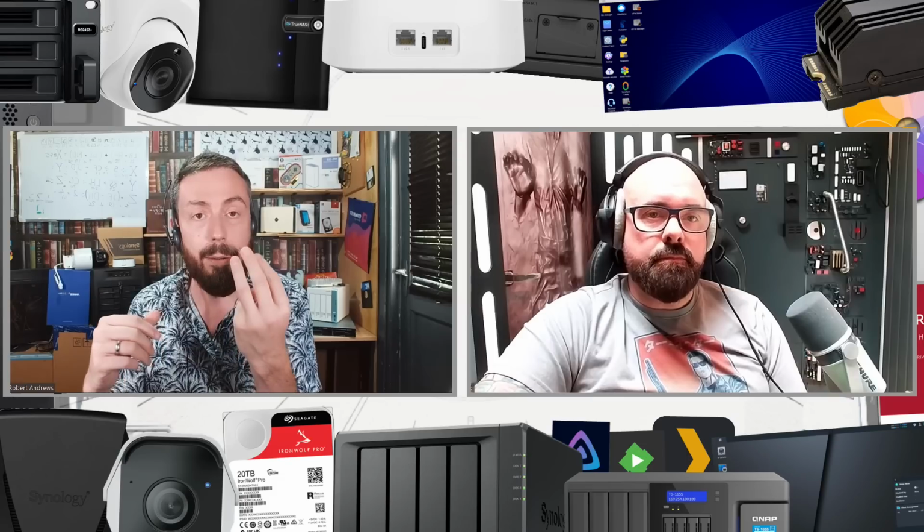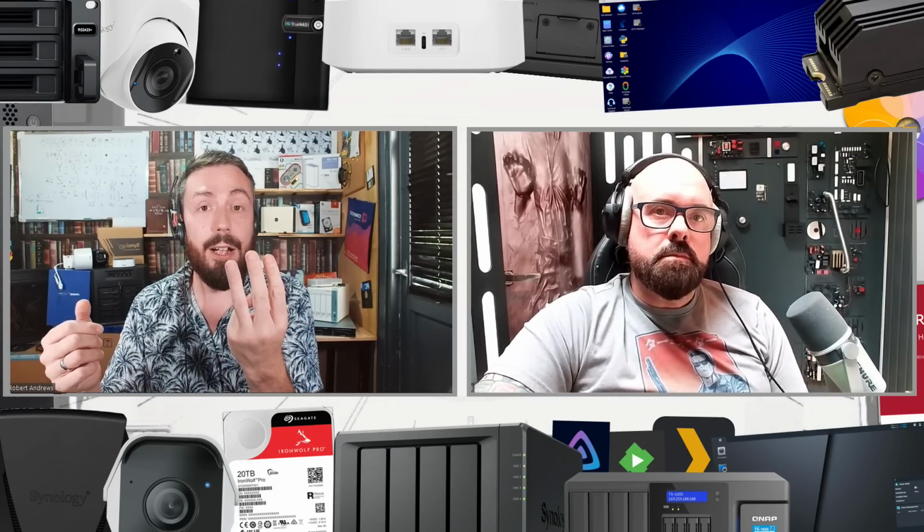And then you've got flexible RAID systems, such as from TerraMaster and Synology, which do allow you to mix and match the drives at the cost of a small performance dip. But you can maybe go on day one in a 6-bay system. The first day, you've got 3 drives in a RAID 5. Oh, sorry, a Synology Hybrid RAID, flexible. It's their equivalent of a RAID 5. And then later on, you can add a few 10 TBs, and it will adopt those large capacities into that environment. But nevertheless, you're still left with that limited ecosystem physical expansion environment,